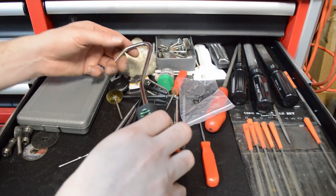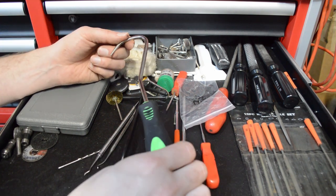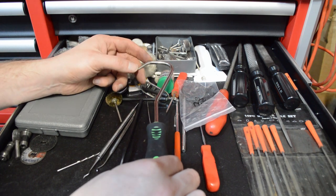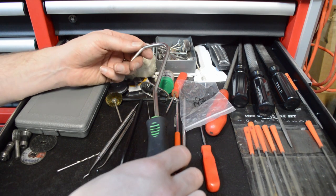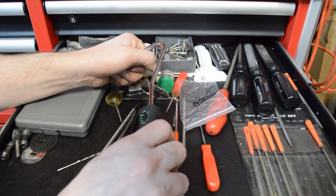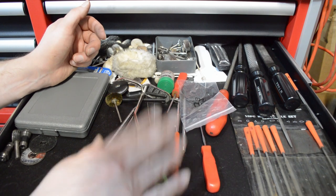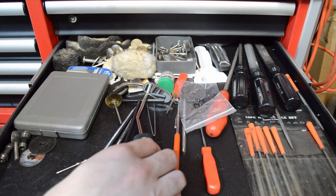I love this tool — it's for pulling coolant hoses and it's basically a hook. I picked it up at AutoZone. If you've ever tried to remove a coolant hose from a water pump just by twisting it by hand, you end up with very dry hands and it's just not comfortable. With this you hook it in between the hose and whatever you're trying to remove it from, move it around, and it breaks the hose free. Twists right off. They're not very expensive, and while you can get by without it, it's a great tool to have.